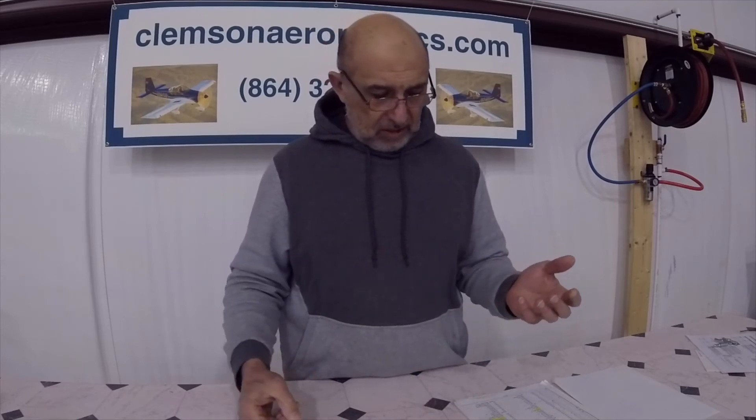All you have to do is Google it and you'll find many places that tell you what kind of nut plate it is. Be careful before you run a tap through anything in the airplane because a screw doesn't want to go through — find out why. Some of those are one-time use, so like a nylon nut, once you use it and take it off you shouldn't put it back on; you have to get a new one.